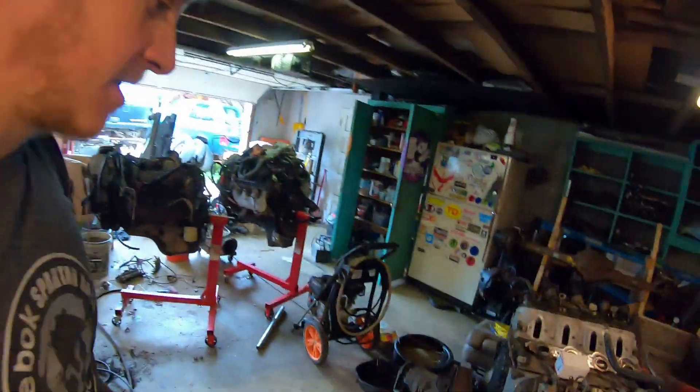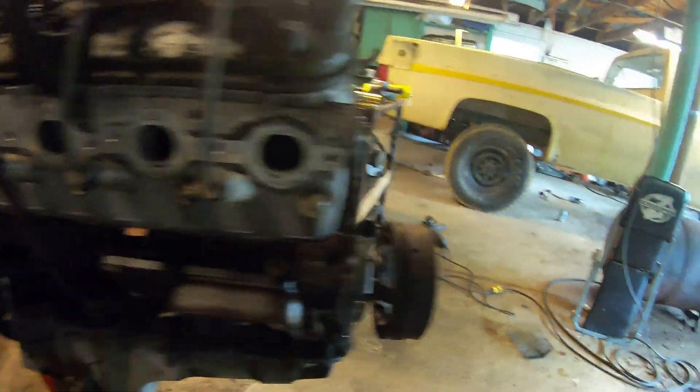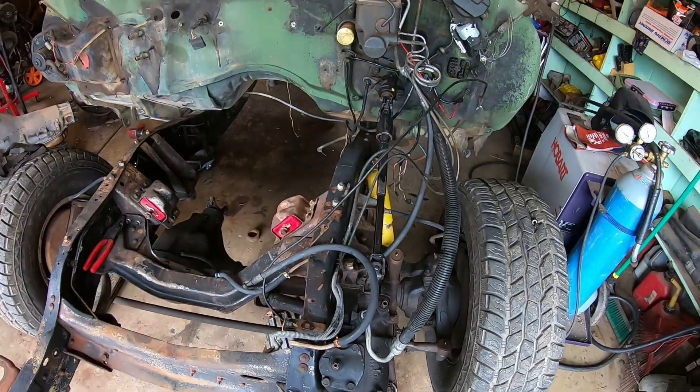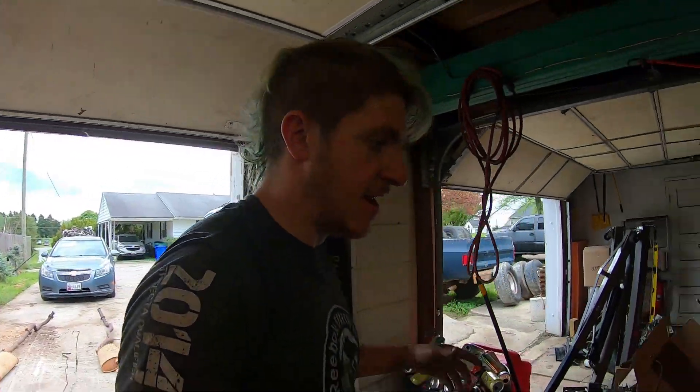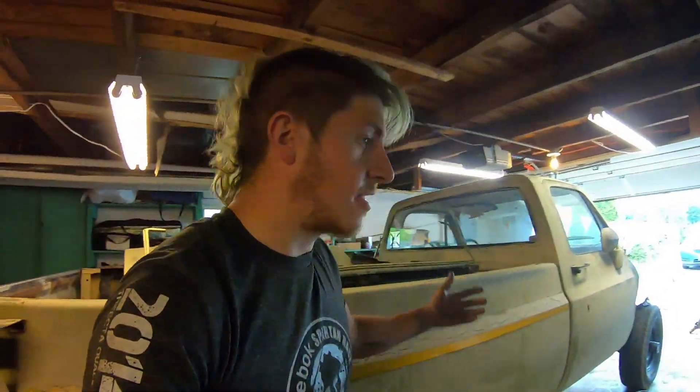I think I'm going to call it a day — got a lot done. We got our adapter plates and motor mounts installed on the engine, urethane mounts put into the clamshells for the frame side, and urethane cab mounts installed. We've tidied up some wiring and got our two-wheel drive gearbox and XJ steering shaft installed. The next thing I'll do is probably build the transmission to handle all the power I can throw at it. Outside of that, I'll be waiting for parts until I can get to the next step. Thanks so much for watching — make sure you subscribe to see all the progress as we get closer to having this truck back on the road.